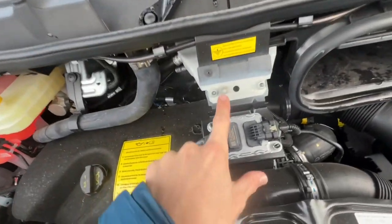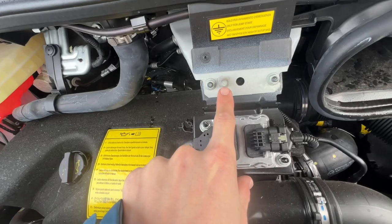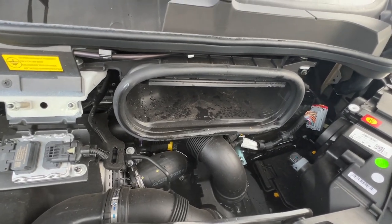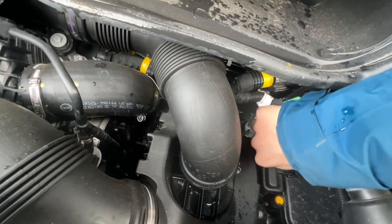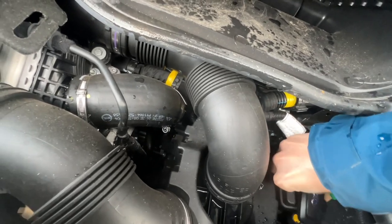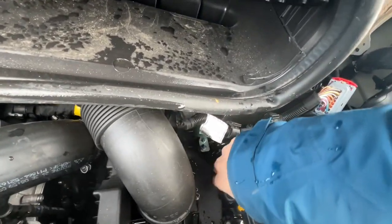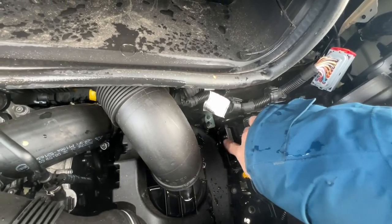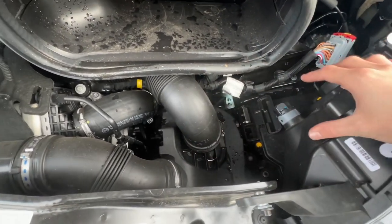There's a paint code on this sticker. For giving or receiving a jump start, because the battery is underneath the cab floor, you can jump the van from the positive terminal here - pop your key or a flat-headed screwdriver in just down here to access your positive terminal, which is near your air intake. Your fuse board is behind the passenger headlight.